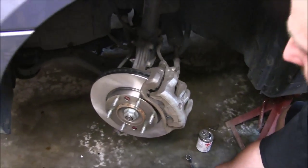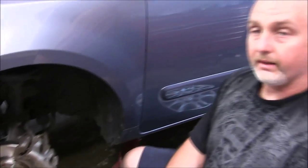Friends, we're actually done with half of the brake job. We've got the left side done — all we have to do now is go to the right side and do the same maneuvers. A couple other things to make sure you do: get your wheels put back on and torque the lug nuts down to the proper specification, then lower the car back down. Pump your pedal up before you put it in gear and take off, or you'll end up running into something — you definitely have to pump that pedal to get the pads up against the rotors again. Very important. After that, top off your brake fluid level, take it for a nice little test drive, and do some easy light braking to bed your pads in. Thank you for watching — don't forget to subscribe and tell a friend about us. Have a great day!